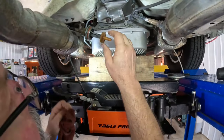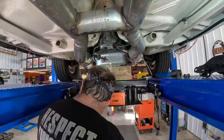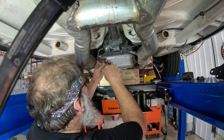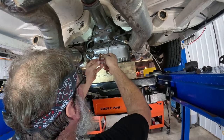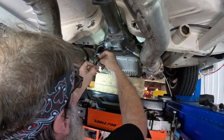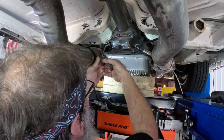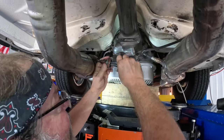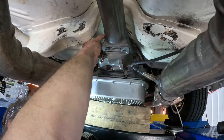Okay. Now, you know what, I got an O-ring here. Let's just go ahead and put a fresh O-ring on. A new one? Yes, sir. We got a small little flat screwdriver? Spanky new one. I love new parts. I do too. Okay. Use some of that little tranny fluid and just kind of get her a little wet. That should be good. Now go ahead and slide her back up into its home there. I want to make sure I get it where it was.